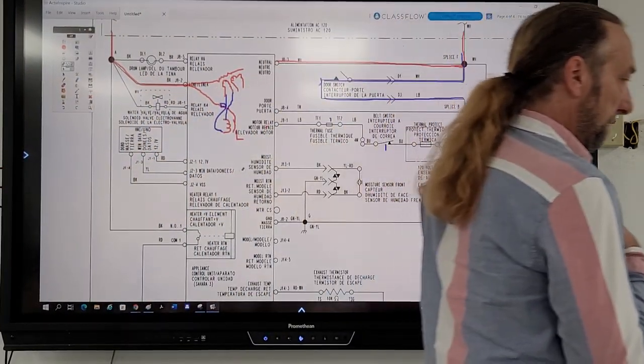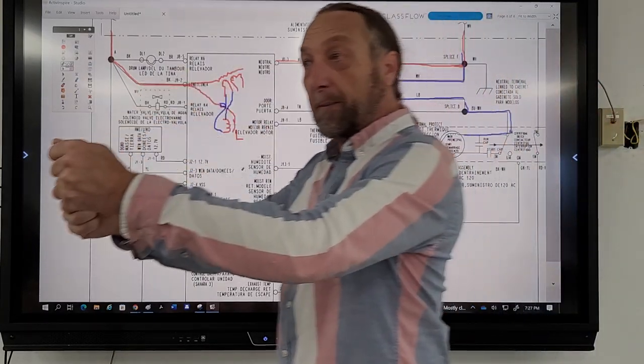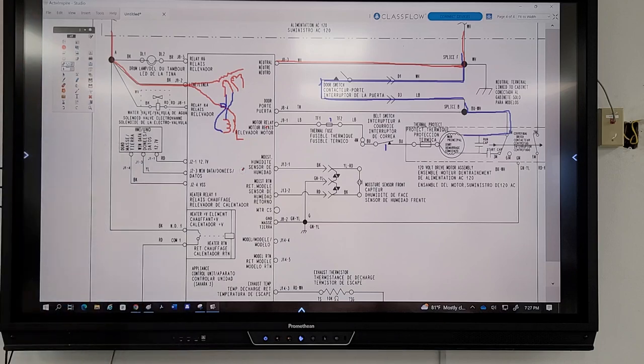You could do J91 to... Well, you could do that, or you can jump straight ahead. I mean, J91 to what though? You got two meter leads. Where do I put both my meter leads? You could either do J91 to TF2, or you can jump to the... I can't even see the other one on the board. I can't tell you where. Get closer. So here's J91. Put a meter lead right there. Yes. Now what? You could do it to...